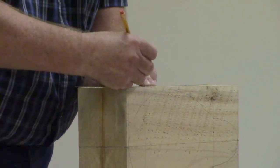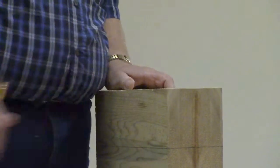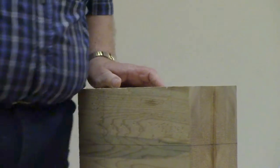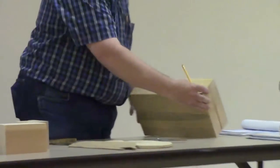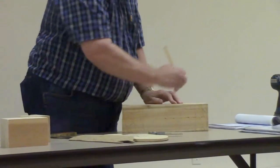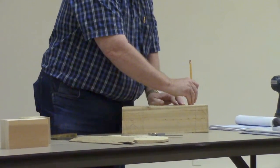out to the front. I don't know if it's just me or maybe you guys think that's where you should tilt your head. No, keep that cut square to your block. I mean, you can always adjust your head cut when you get ready to do that, but keep that flat. So when you drill your hole later on, when this top is removed and this piece is off here, now you're drilling your hole for your head through a flat piece of block. It's 90 degrees again.